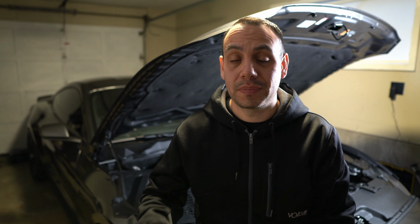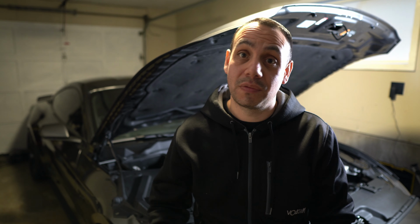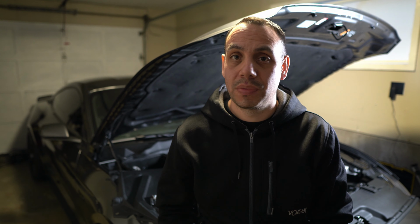It was getting a bunch of warnings on the screen and didn't want to crank correctly. It did start up a couple of times, ran for a few seconds, and died. I was still thinking that we weren't quite seeing enough voltage to the PCM, so it kind of trips out a little bit. So anyways, let's jump forward to now. I got a new battery, and let's get that installed and see if we're still having the same problems. Thinking maybe we lost a tune or some alarm type problem. Anyways, let's see what happens. Let's get that battery in.